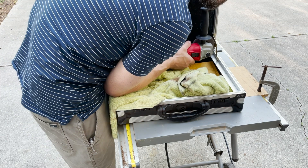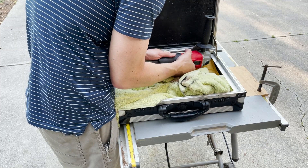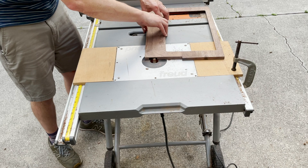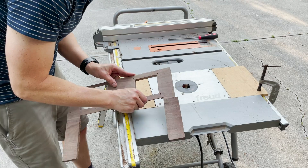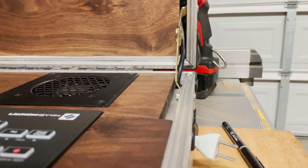In the redesign phase, one of the reasons I didn't think I was going to be able to make a makeshift laptop work was because I wasn't sure how I was going to get a power and a signal cable from the Apple Mac Mini up to the Pixio portable monitor. The solution was to route out a little raceway for those wires, grind out some of that aluminum ledger and file it really nicely, then take a little of the false floor corner off. And you can see it works really well in letting those cables freely slide as you open and close the lid.